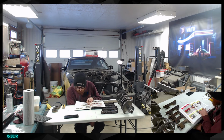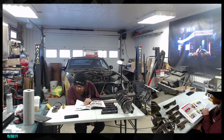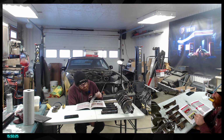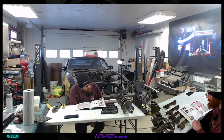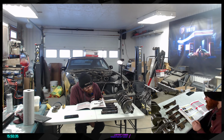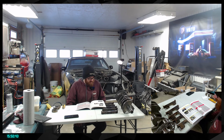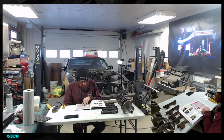What are they doing? All right, after that we need to have the crank in place, and then we're going to be checking the rod bearing clearance and the rod side clearance. So we have a feeler gauge for that, that's all good. And we're even going to check if everything clears the side of the cylinder. So, cool. Then position here.